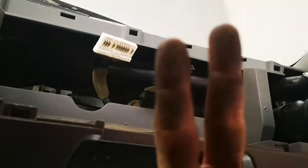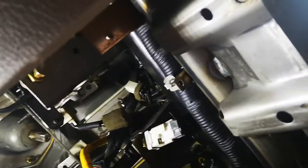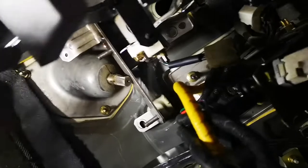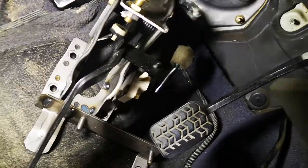What Kia's done is there's a slot on top, so it goes up there and the nut goes on. I've chosen to take it off and I'm quite thankful for that because there's not much room to wiggle around because of this duct. The clutch cable has sort of damaged itself, but the pedal box — that's the first time I'm taking it out. The pedal box is damaged and I'll show you where. I think people are replacing clutches for this issue.